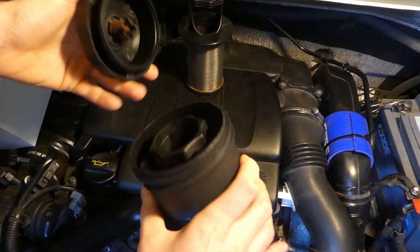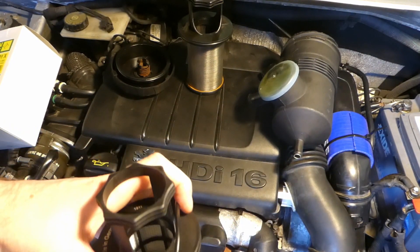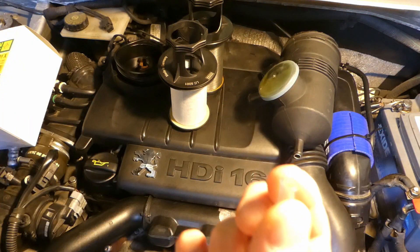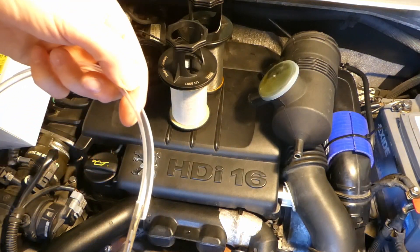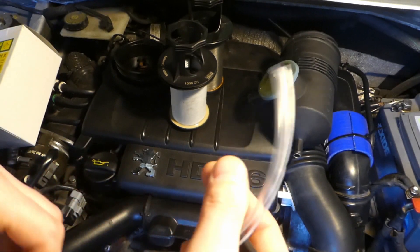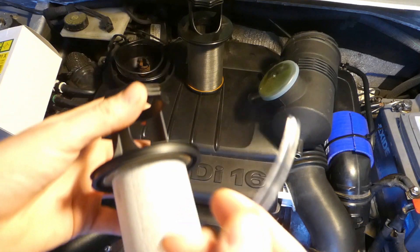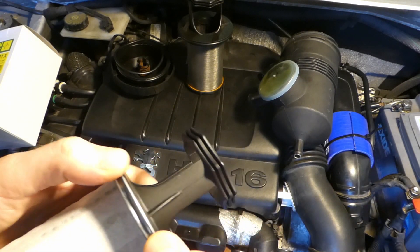What you can do is remove the O-ring using some sort of tool, and you're left with just the filter body. Then you get a piece of silicone tube — anything quite small, it doesn't really matter — and cut a small piece with scissors, something like this. This is the same diameter, so you can put it in the groove here.